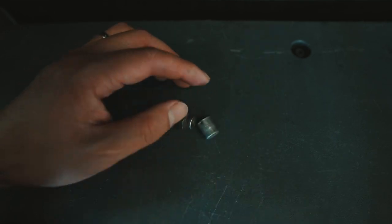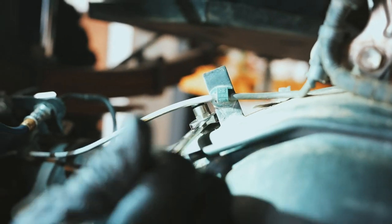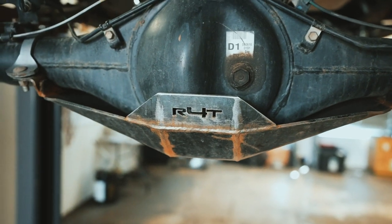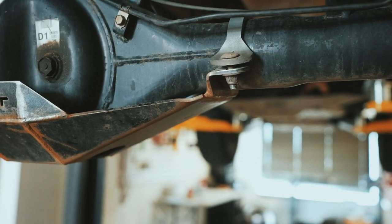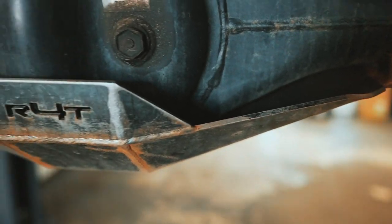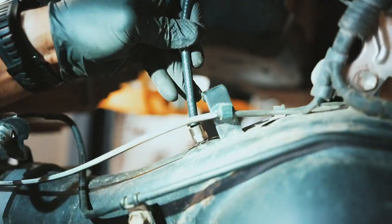The ARB replacement has a plastic piece on the top to connect with the air hose we're installing. We're going to break the factory breather loose and take it completely off, then replace it with the ARB unit. We'll tighten this all the way down - note that this bracket is raw metal which is why you see some rust; we just wanted to make sure everything fits and it's plenty thick so no issues with denting. Once fully tightened, we'll plug our line in.